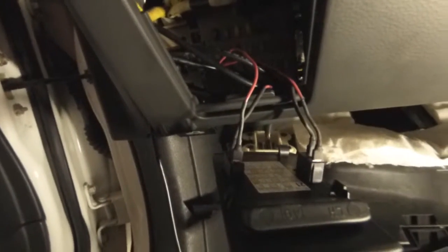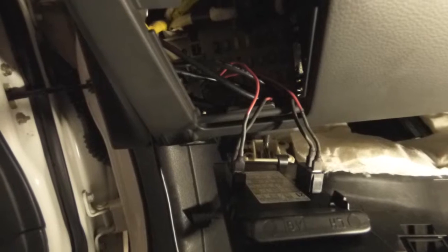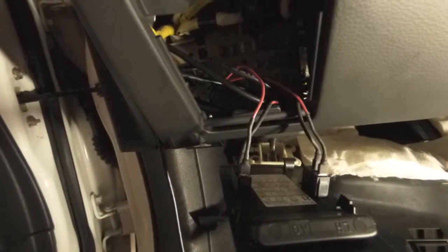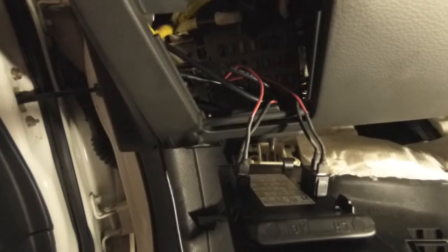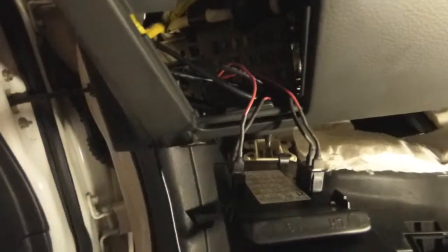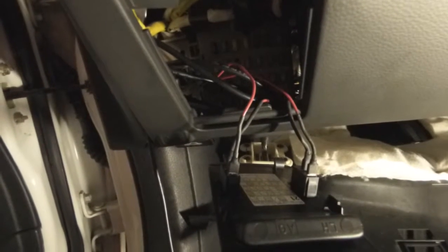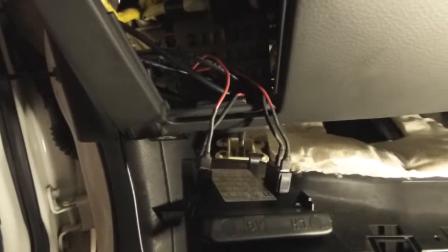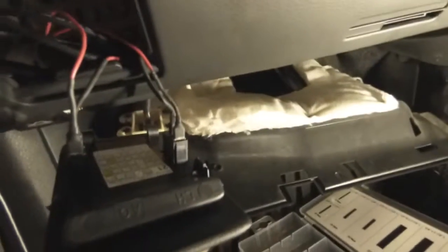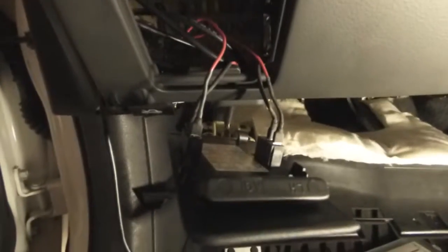Then for the lights and we'll be good to go. Always double-check any wiring you're doing to make sure you didn't cross something or short something out. Continuity is pretty easy — if you are shorting out somewhere it won't tell you that because you still have a solid piece of wire, but it can at least tell you which wire is which. Always do that with power off. Looks good — I'll be able to tighten things up underneath here, get it all cleaned up, and then hopefully next time we'll get it switched on.